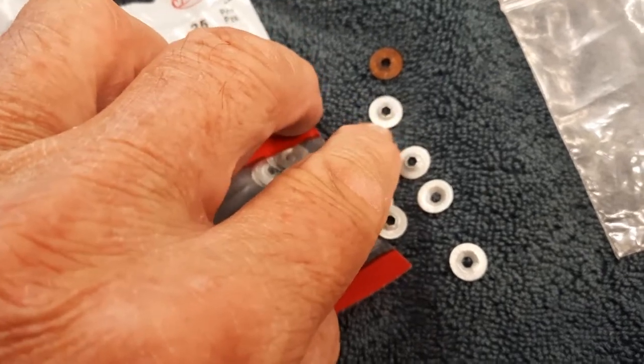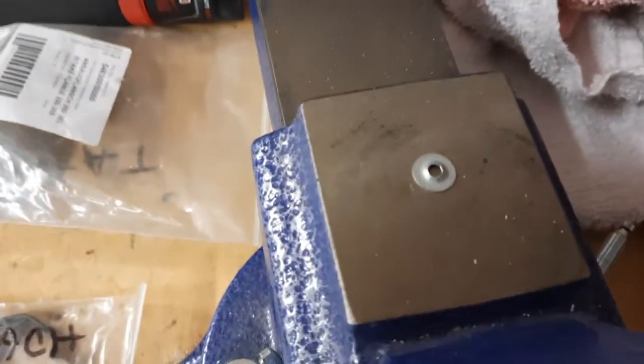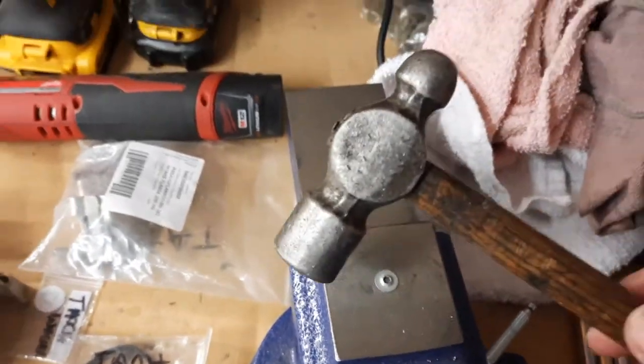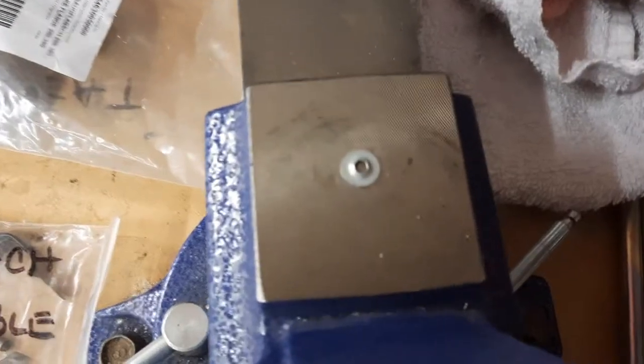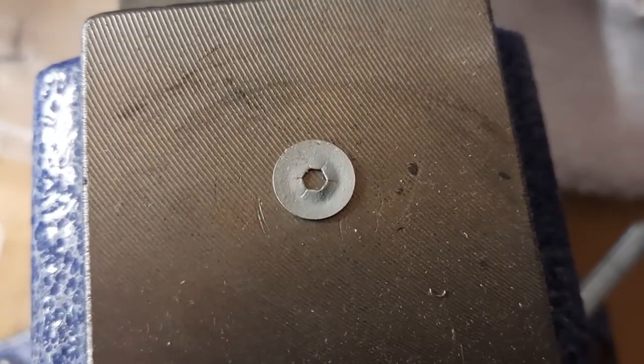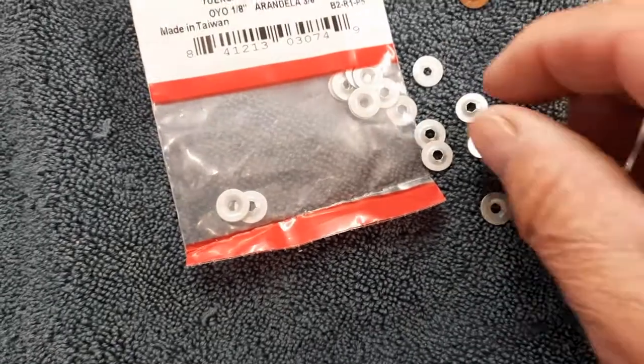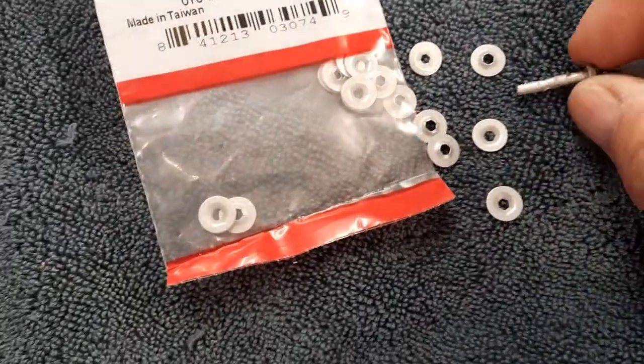Now, I basically took this, and I'll show you. It's a tad bit bigger than the stock one. So what I do is I've got a little hammer, and that's a very little hammer, and you can see how it's peaked up. And if you pop it once or maybe twice, it flattens, and that will make the clip smaller, and it's almost too tight. So just in its original shape, it goes on to these pins that hold this chrome strip.